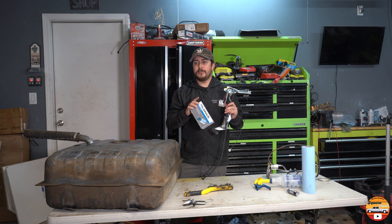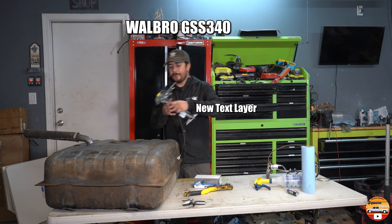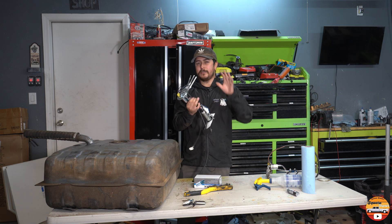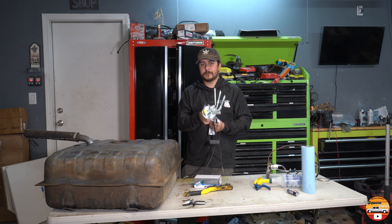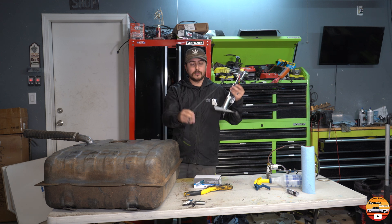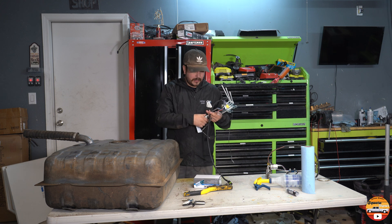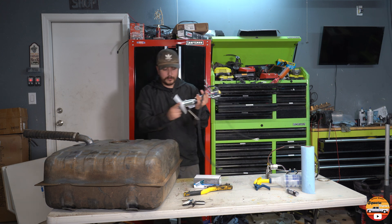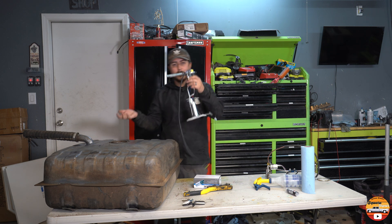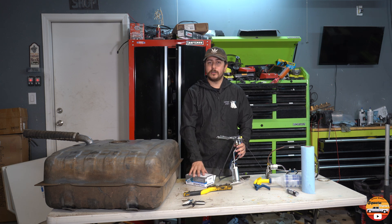This thing should supply us ample fuel for our LS swap. If you guys are looking to put power to your vehicle right away, you'll want to look at the Walbro GSS340 - that thing pumps out about 255 liters per hour and should hold you up to right around 500 horsepower naturally aspirated. We're not planning on making 500 horsepower, so this old '97 fuel pump should do the trick. We're just going to mount our fuel pump into the sending unit, put our fuel sock on, connect our hose to our piping, and drop this in. After we get it in, we're going to make a couple modifications to make it work a little better for us.